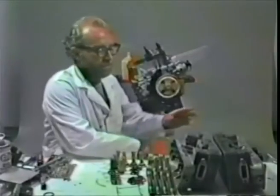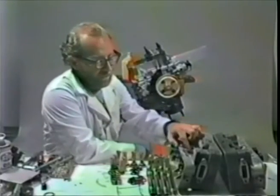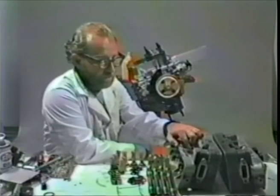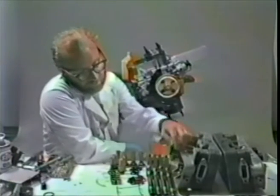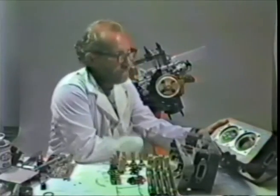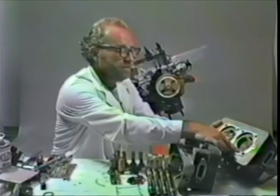Assemble the cylinder heads. These are the cylinder heads we just saw having had a valve job. We've enlarged the ports here to take the Solex intake manifolds for the Weber conversions. Put in brand new exhaust and intake valves. We surfaced the cylinder head so it's all nice and clean. And we cleaned up the one cylinder head that had the chunked piston.